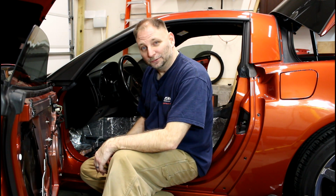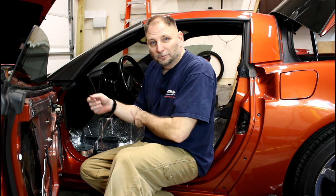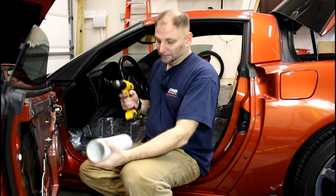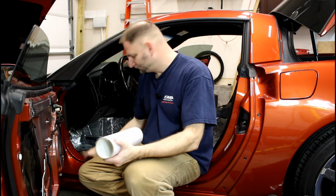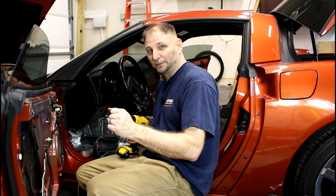We got our plastic trim piece removed. How the cluck do you run the wire through it? Well, a good way is to drill through that plastic piece. Before you drill, know how big a hole you have to do. Take a piece of cardboard, put a hole in it. Perfect. Go super slow. This is super thin plastic.